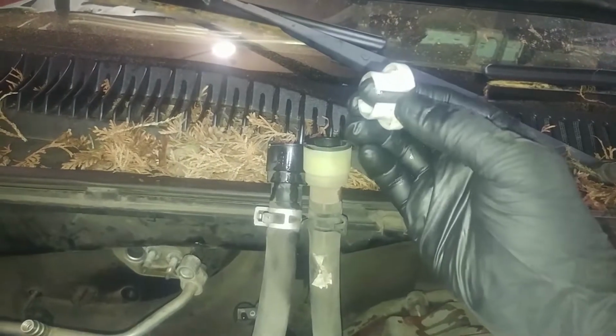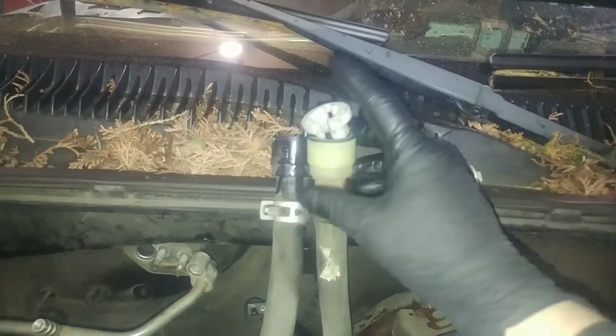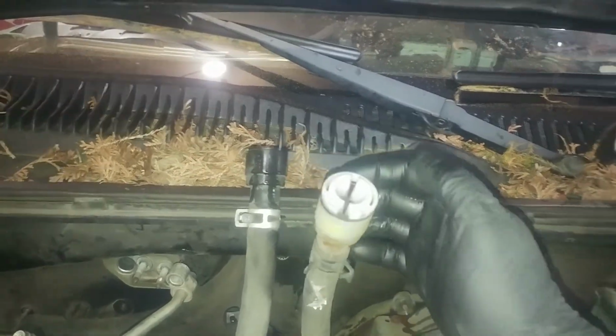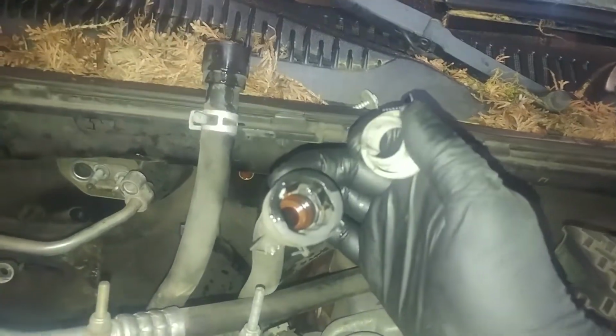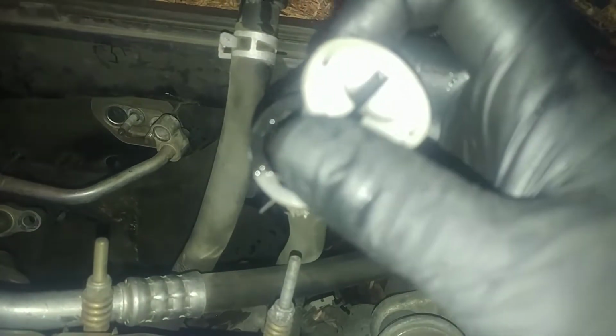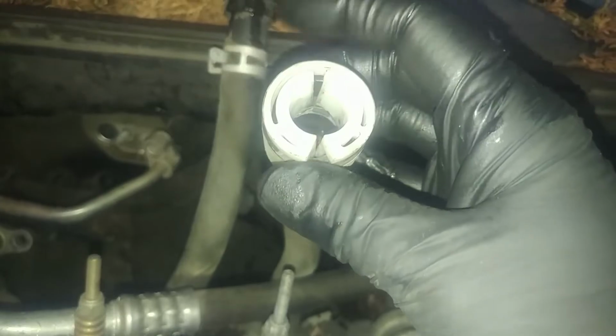And then we'll disconnect the heater hoses. Nice, special tool needed. So a recommendation is maybe to cut the heater hoses, tubes inside the vehicle, then pull those out in the engine compartment. It makes it easier to work on and disconnect. Here's a special tool. Wraps around the pipe. You slide it in. It does take a bit of finger effort. And it goes in there, then you can release it, because it's pushing on little plastic tabs. You can see in there, so this on the pipe will spread the tabs. And you can slide it off.